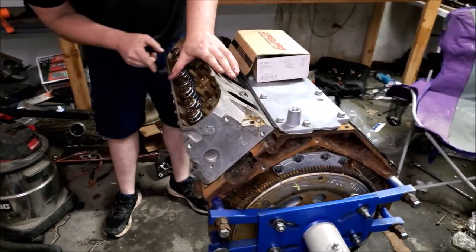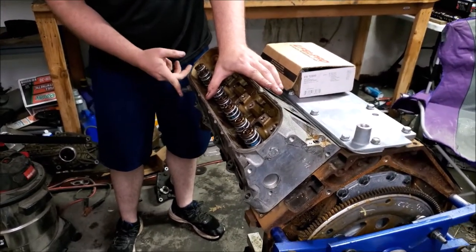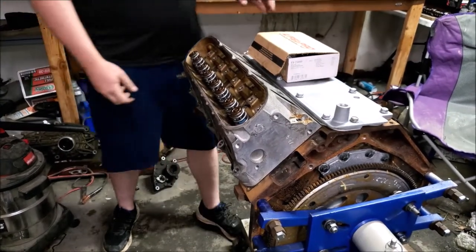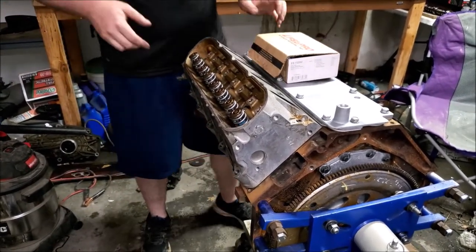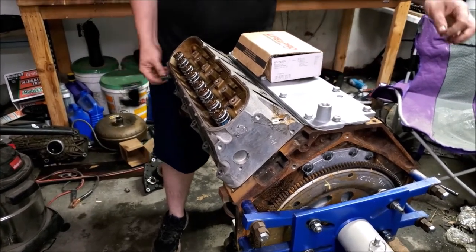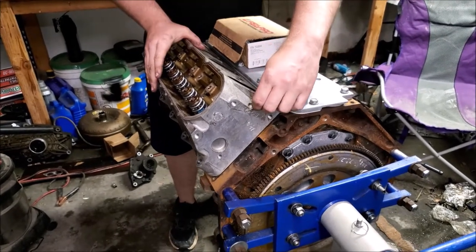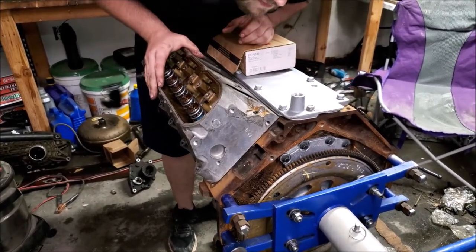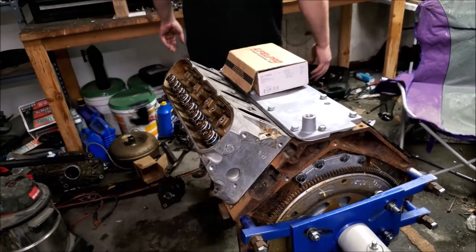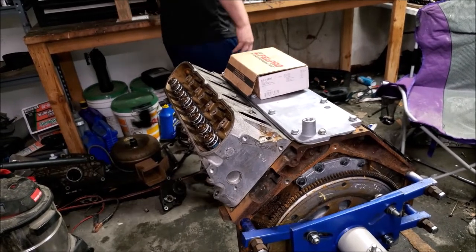But make sure this is your coolant temperature sensor. Make sure that's on the front on the driver's side of the vehicle. Otherwise, your plug isn't going to reach. You can always take the plug out of one head and then put this in one side. Just swap the plug and the sensor, but it's a pain. And why, when you could just do that? I'm going to show you the torque sequence, and then I'm going to show you the torque specs.